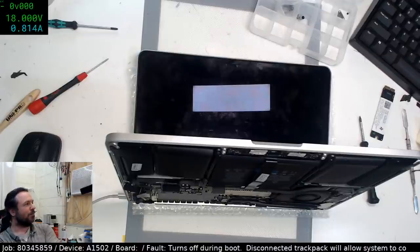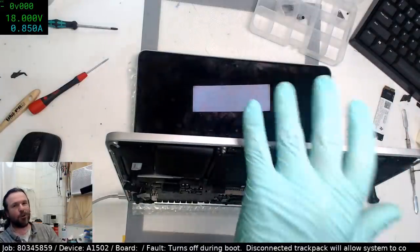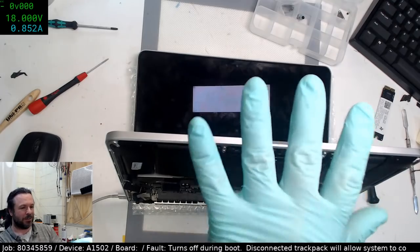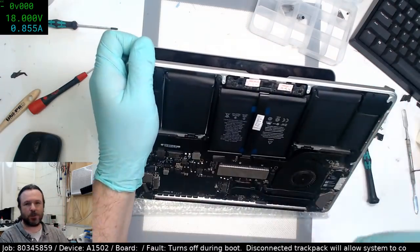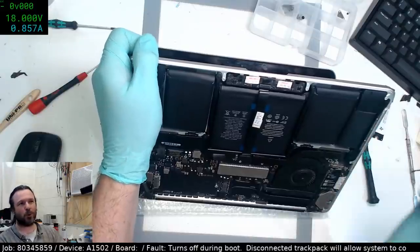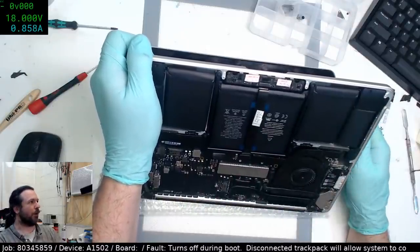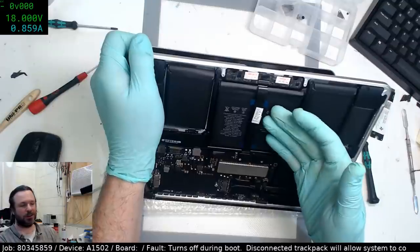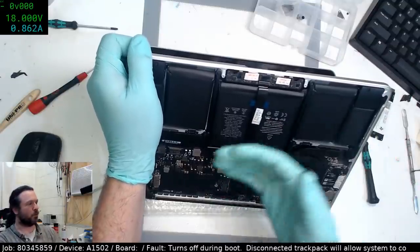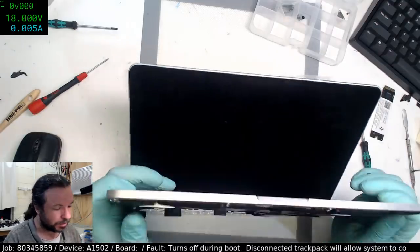Yeah, powered up straight away. So I think what's happened here, judging by the fact that this is still running, is that they ended up replacing the wrong end of the chain. That is where these machines are a little bit queer. Weird. I don't know why I said it. We've got the flashing file. Yeah. It's where these machines are a little bit weird. Quirky is what I actually wanted to say, but I was thinking quirky and weird, and it came out the word I didn't want to say. Just the way that the keyboard signals are pushed through on the trackpad cable as well. So by disconnecting the trackpad, they broke the chain, so it would stop it from shutting down, but it was a link too far rather than coming all the way back to the keyboard. So I'd say this is basically just a buggered keyboard.